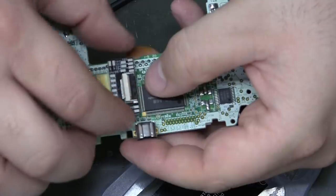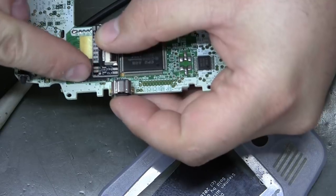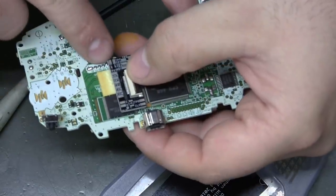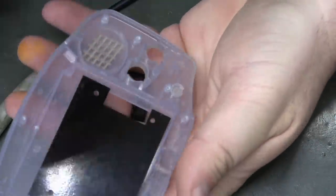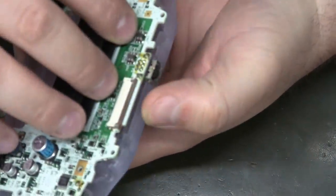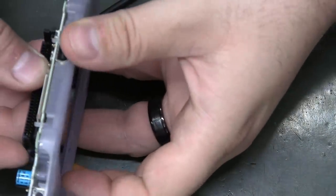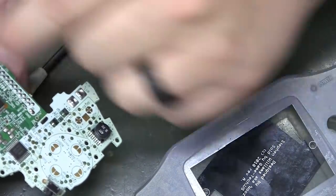It's way too big a piece of double-sided tape, so keep it even with the top of that. I believe it's a RAM chip, U2, and then keep it over that way far enough to leave C2 uncovered. And then you just lay your blank PCB right there. Lay your motherboard back in and just double check it. And we're good. And I want to say that rib is right there. Just goes right there across the back of that connector and on top of that RAM chip.